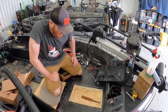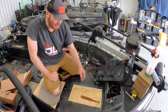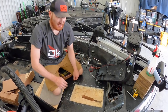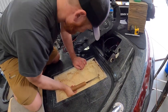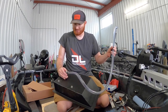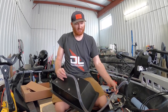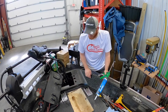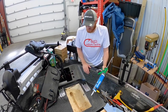We've got the compartment pretty well cut out, but now I'm just using a file to make a little channel so we can drain this out to one of the drains that's already in the boat. We've got plenty of depth left, and now we're making basically a little tunnel so we can get our tube through from the drain right down into the bilge drain. We attached our drain hose — it's got a little barb on it, but I'm going to put a hose clamp on it just to be safe, because if this was to come off, that water draining in there would be a bad deal. We're getting ready to put the tray in, so I'm just going to lay a little bead of silicone down all around the edge.